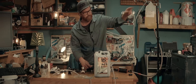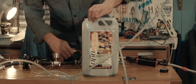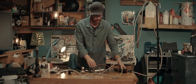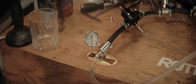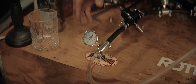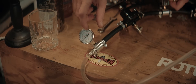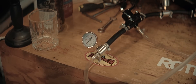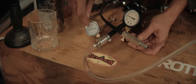Let's give it some power and see if the pump works, and as soon as I see fuel here I'll put this into the main tank. I'm not sure if the pump is supposed to sound like this — let's check the pressure out of the regulator. We're seeing almost 3 psi. This is with atmospheric pressure to the regulator. Now I'm going to use this pump and see how it behaves when I give it some boost — it should be a linear rise. And that's not what's happening. Let's see if bringing the base pressure higher helps.